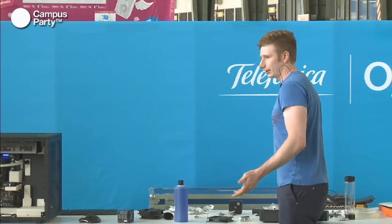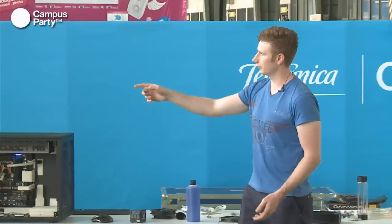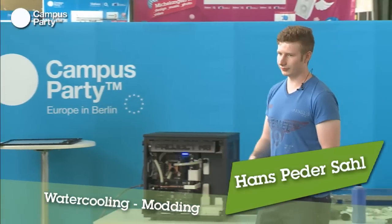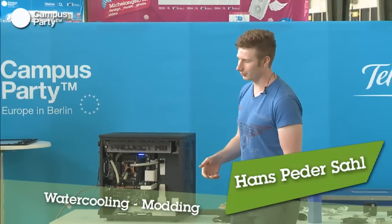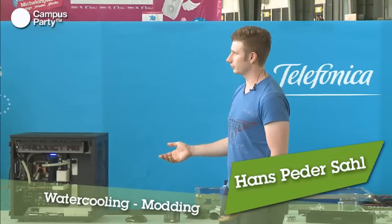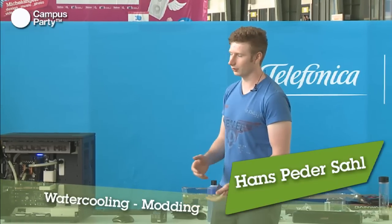And if you want a very silent system, you can take low fin per inch, which is the one over to the left, and you can use very slow moving fans for this. So the general rule is, if you have high fin per inch, you want high speed fans, and if you have low fin per inch, you want low speed fans.